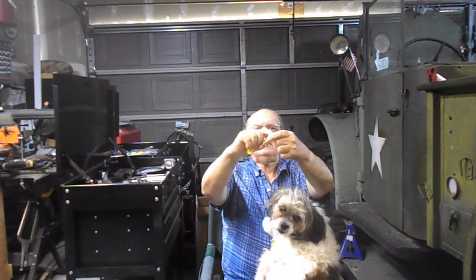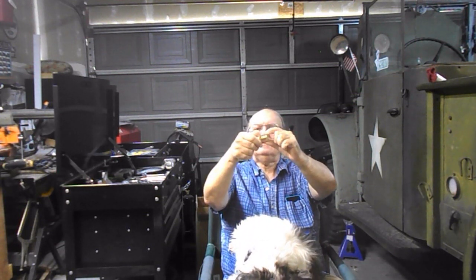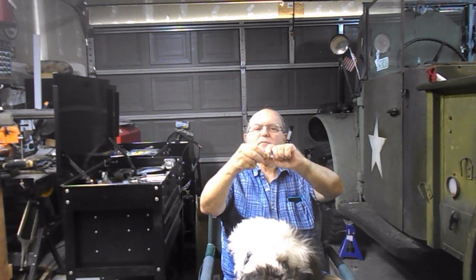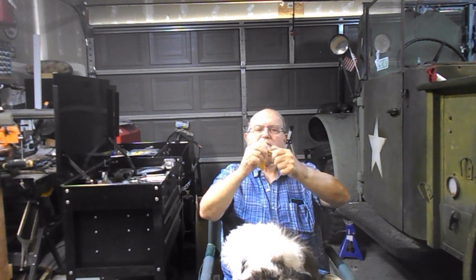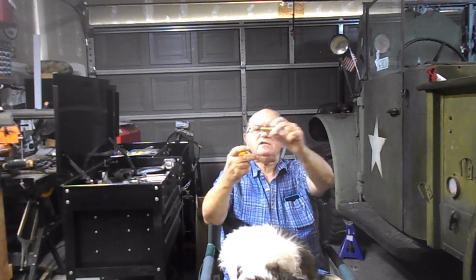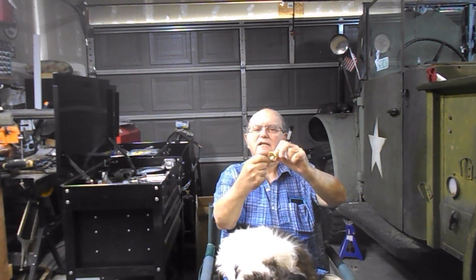This is a bulkhead fitting. So you drill a hole on the bottom of the jerry can, off to one side, whatever, and then you put this in, and it's a little tricky getting the other nut on, but it does work. Figured it out. And you can do it any bunch of different ways. But yeah, so that goes in from the front, and then inside you go ahead and you'll lock that down. All you gotta do is really hold on to that.